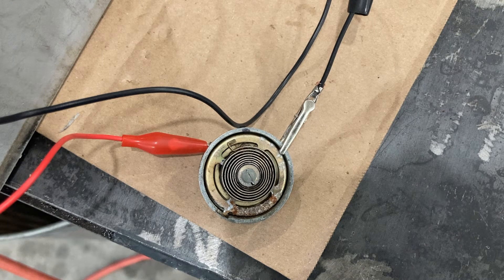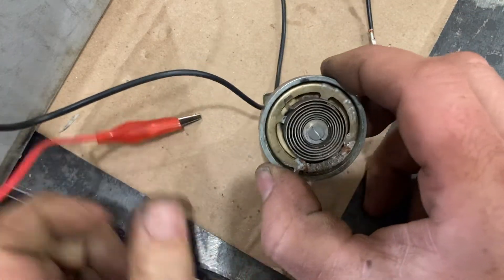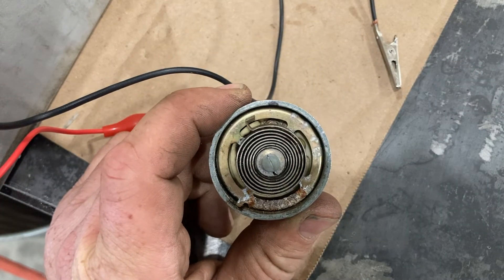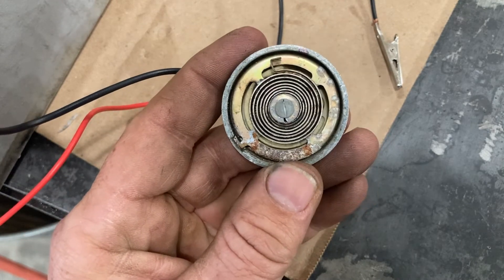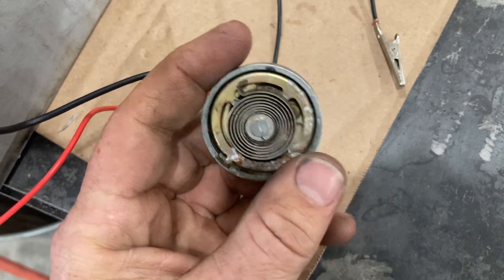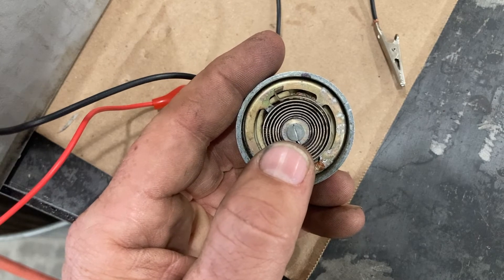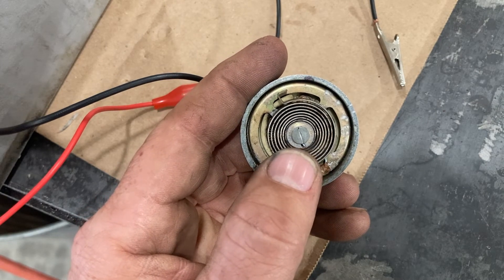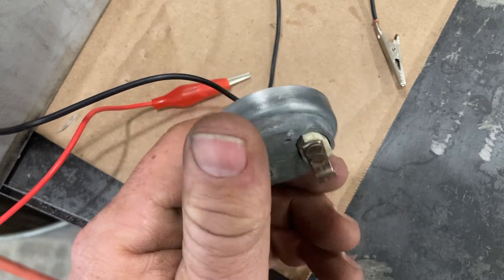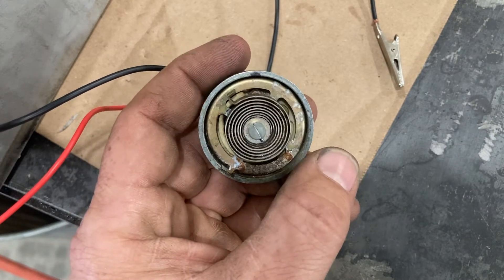So you get the point of it here — we can see and watch it. Now if I disconnect this, it's not immediately going to retract, because every time you shut the car off, you don't want the choke to go back on if the car is already warmed up. I can feel this having warmth in my hand — it's physically warm to the touch. Obviously this will expand a little bit faster if the car is running, just because you're going to get heat from ambient temperature inside the engine bay. That will keep it open. If I go put this in the fridge, which I've done, it'll very quickly retract back down and the choke would be on again.